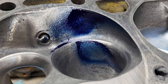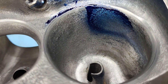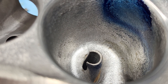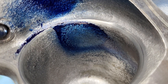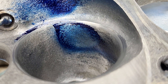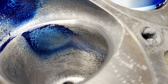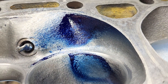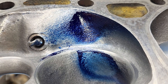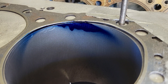The throttle body injection swirl port cut to a straight port — finally. I took a big chunk of the guide out, not my usual high level of work, but I pretty much had it with these things. Notice how our liquid has changed quite a bit: it's much narrower, doesn't go down to the bowl as deep, doesn't go around the short side as much. Looks quite like it did last time we saw it on the chamber on the plug.